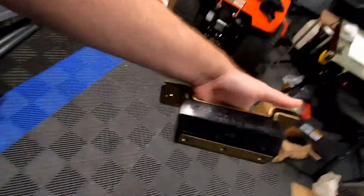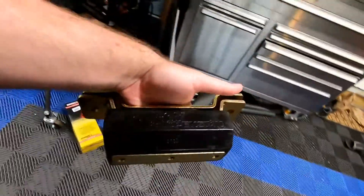You don't want to mix rubber and poly — you kind of want to go full rubber or full poly. Since we've already replaced the engine mounts, we want to replace the last mount with this polyurethane mount.